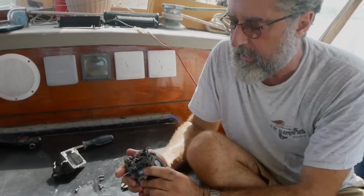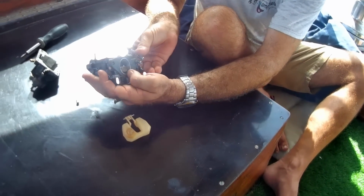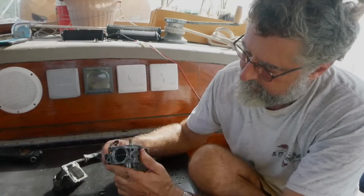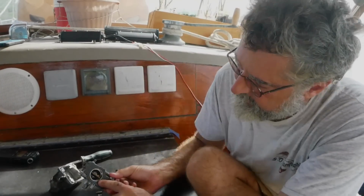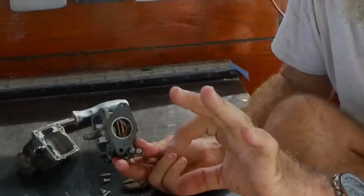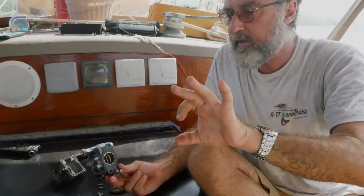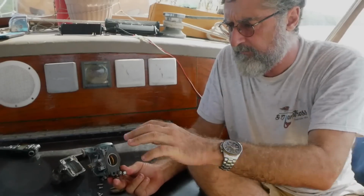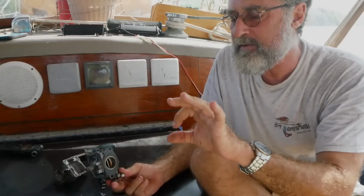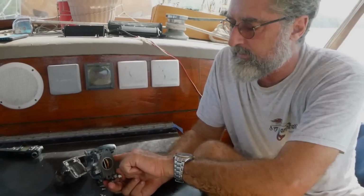And what actually is happening, this is the choke plate, and behind that is the throttle plate. This is what you actually activate when you twist the control. I'm holding them open so we can sort of see. A little hard to see. But if you look in there, you'll see that it gets narrow and then it gets wide again. The airflow area goes small and big. Where it goes small, the airflow through the engine is forced to accelerate. It's called Bernoulli's principle: when you make air accelerate, its pressure goes down. So you've got that area with low pressure.